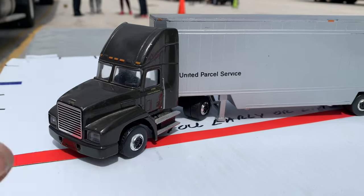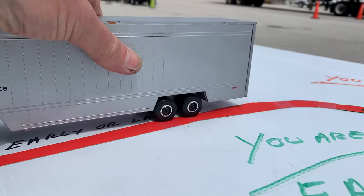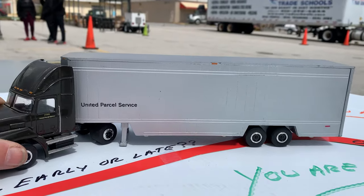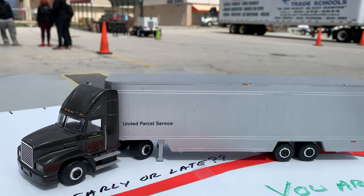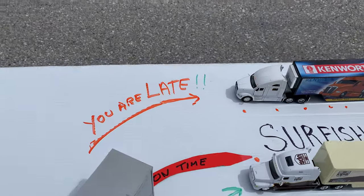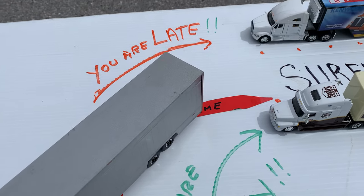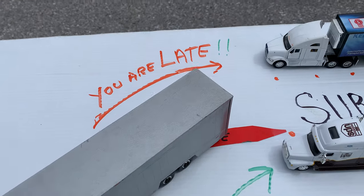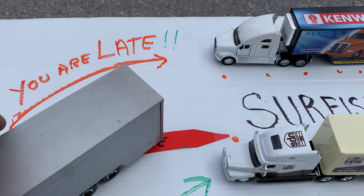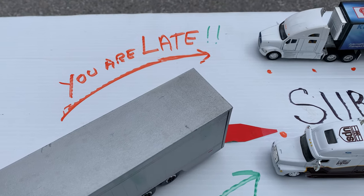He's going to get his drive tire straight. Make sure you don't have it all the way back to the right, otherwise it's going to come back in. Small setup — he's going to back up a little bit, maybe to the left half of the truck and trailer, and stop. He's going to determine: is he on time, late, or early? If he's on time he can continue backing up. If he's getting a little late, he can come in with a right to bring his tractor in a little bit, then counter steer back.